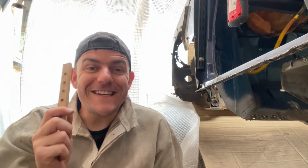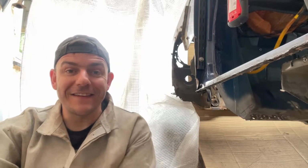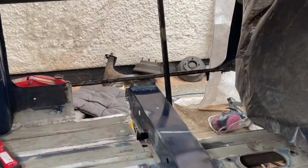So I think I've finally tamed the MIG welder. You'll notice that I'm going a lot slower than I used to with the MIG welding, hence why I've thrown it on time lapse, because although I'm actually welding slower, I'm getting much better results. The earth clamp has helped an absolute ton, so it welds much better now. I'm getting that nice bacon and egg sizzle when I'm welding, exactly how I remember it when I did my MIG welding course back in the day. So I'm getting the results I want. So all that's left to do now is grind down that section.